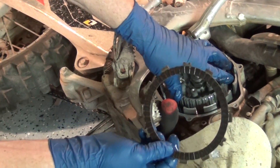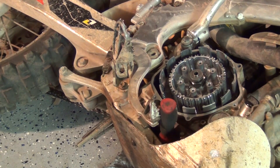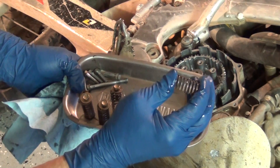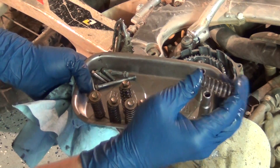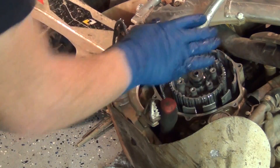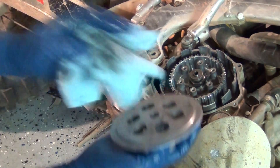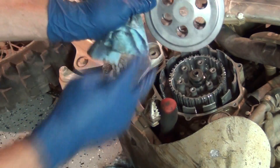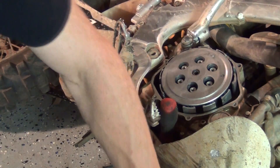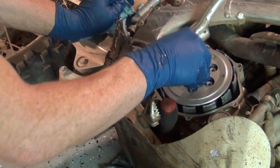The way that these are squeezed — I mentioned earlier that I squeeze down on it and then you can't turn it — is accomplished on the dirt bike with these springs. These springs are pretty heavy duty. You go to squish them by hand and I can get it about that far, squeezing as hard as I can on that little spring. So we've got six of those all holding it in. This is the bottom piece of bread, these are all the condiments, and this is the top piece of bread — I'm using way too many analogies. You'll notice six holes and six holes for the bolts. It goes on like this with all the fixings, the brake rotor and brake pad stuff in there, and you just tighten them down so it holds it all tight.